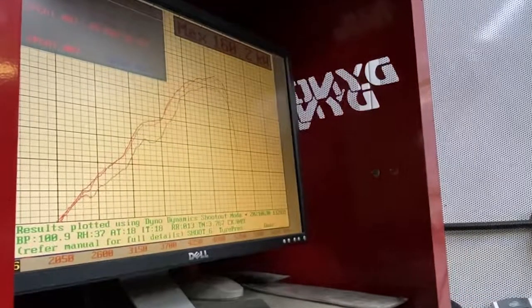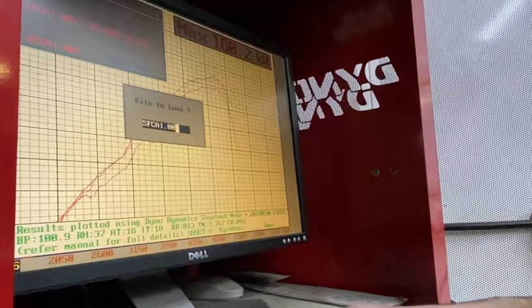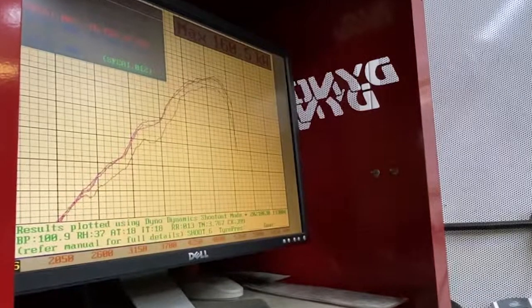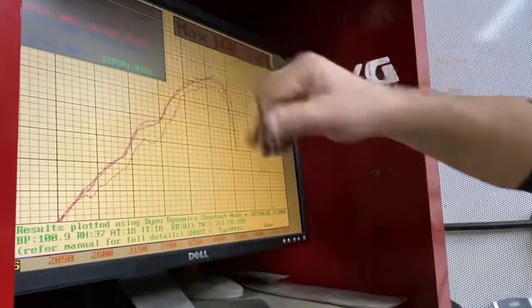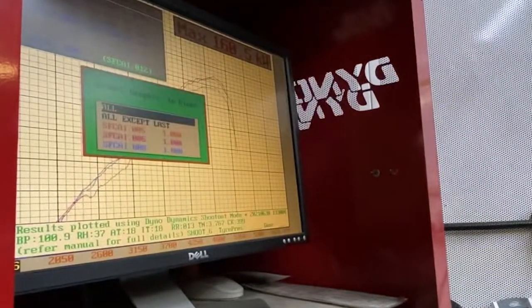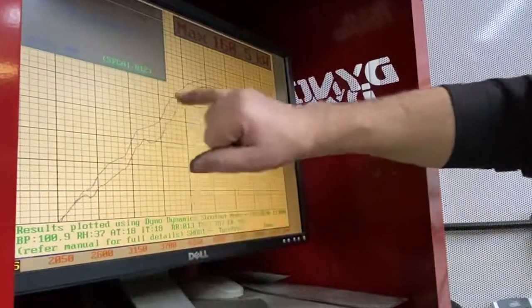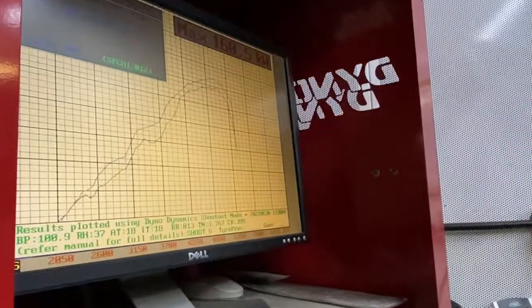Yep, that one backed off a little bit. Where are we up to? Number 8. Okay, let's call it 160. First run, possible anomaly, let's call it 160, 161. So we'll leave the average, I think this one here is the average, 008. We'll leave that one on, get rid of the other two. Okay, so brown, standard airbox. Blue, Street Fighter, full cover airbox. About an 8 to 9 kilowatt increase. That's no tune, airbox only.